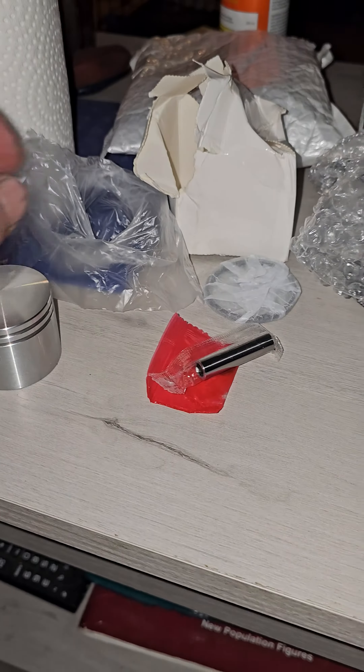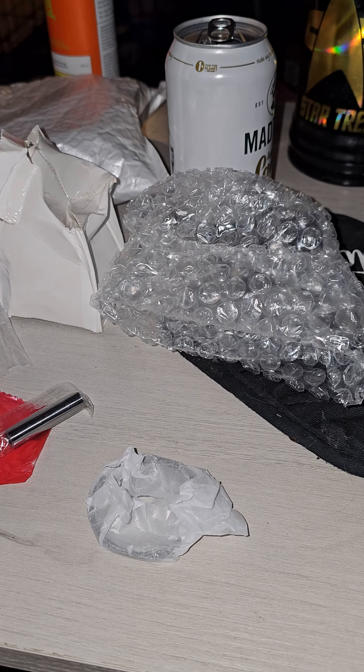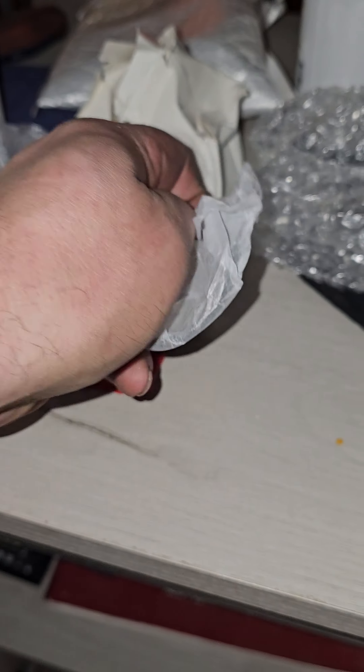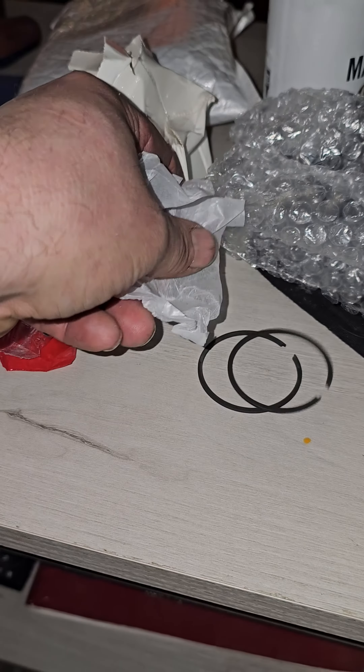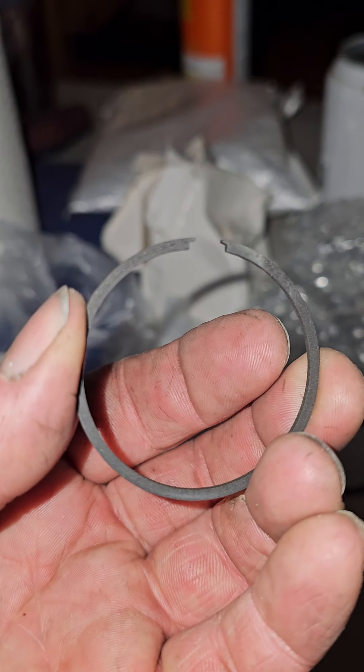Looks alright. It has a pin. What I want to see is the rings — I want to see if they have the good style rings that wrap over top. Judging by how recessed those pins are, I'm guessing the rings will be the kind to go over there, which gives you a crap ton of compression. And they look like they are. So they are the good rings.